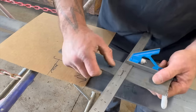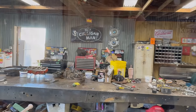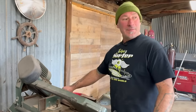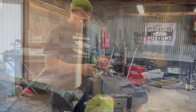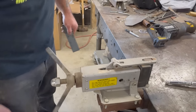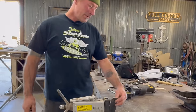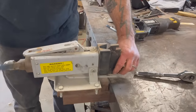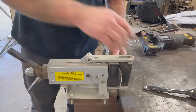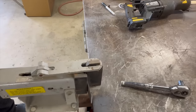We'll just chop this off. I got this cool bender that I've never used — we're going to use it. Cut this. So it just keeps cutting — 18 years into the game, never lubed it once. What is this thing? Plate bender. Woodward Fab. It's a little dusty, been with me for some years. So when you tighten this — see this little guy — when you tighten this, it pulls it in. It's sort of a press brake, but it pulls. So you put your little marks on that.